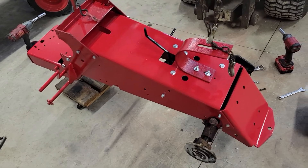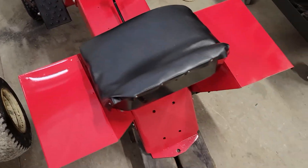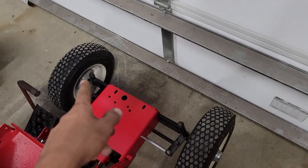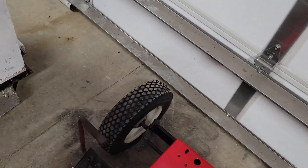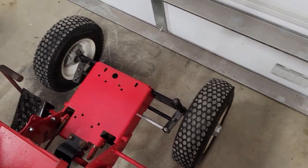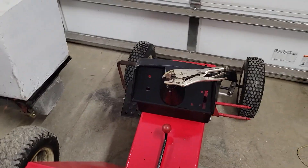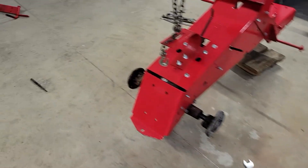I made some progress on them. You're looking at the Custom right now; the Roper is over here. It has front tires on it and the steering stuff put in, no rear tires yet. Steering seems to work — steers both ways, so that's good. These front tires will probably get changed out because they have four-lug hubs and I want to use those on a different project. They were already attached to the spindles off an ST10, and then I realized one of the spindles is actually bent. I can bend it back or just put a different one on.